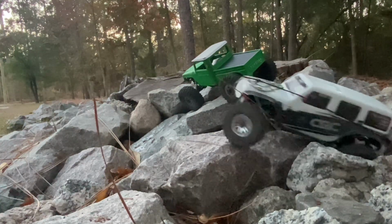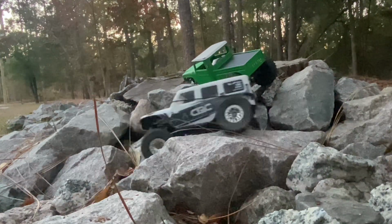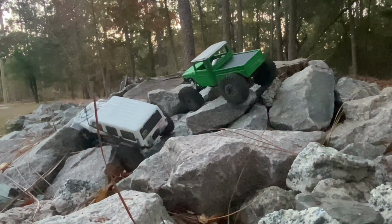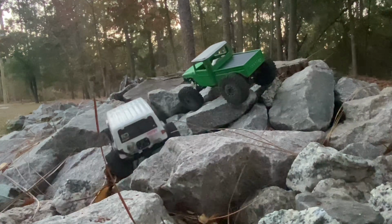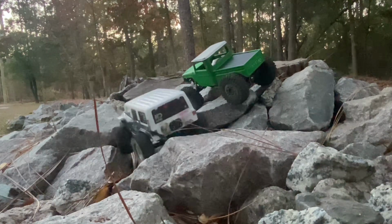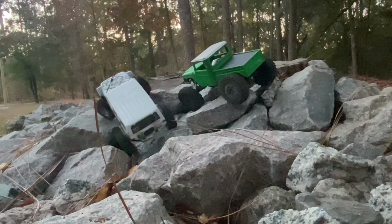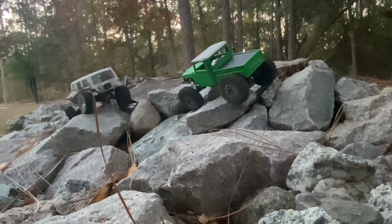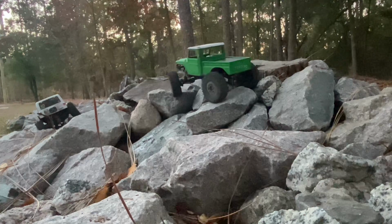Obviously like a reverse pinion, a high pinion, or flipped with everything up higher, reverse-cut gears in it and all that. You can go down those roads too. Once again, that's what the Currie axles are all about, as far as having that smaller center section of the differential, whether it's offset or not. Still, once they're shaved down, shave the diff down, it's a whole different game, right?